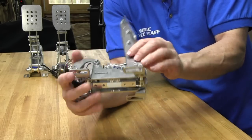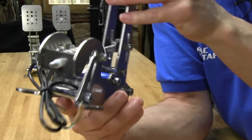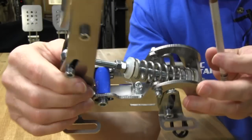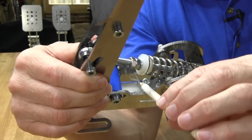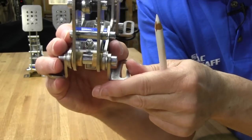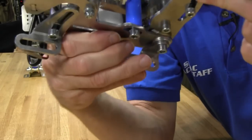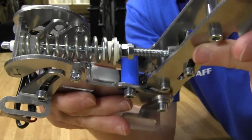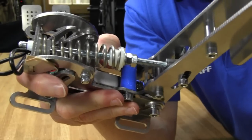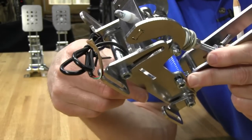It's a very high quality finish everywhere. Looking at how the load cell is set up — there's a piece of acrylic or Lexan that bolts to the back of the load cell. In the front, between the front of the pedal, there's another piece of acrylic with a spring that attaches down to a screw going into the front of the load cell. When you push the pedal, it causes tension to flex the front of the load cell, which sends signals down the wires to the circuit board, which sends USB data to your computer so it knows the pedal position.